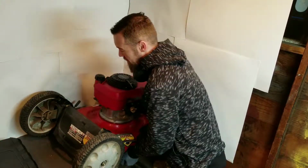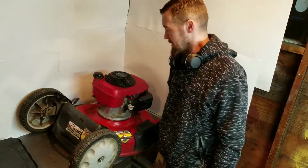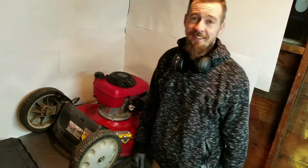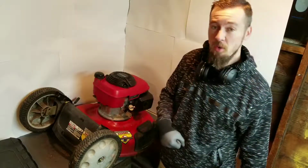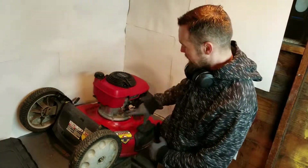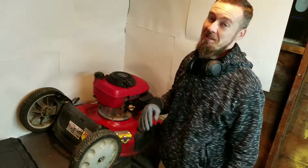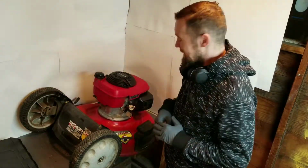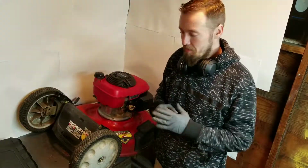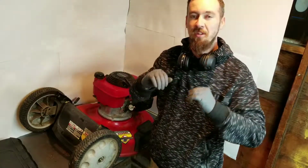And on these particular Honda units, I've had a professional guy come to the shop and tell me that he'd broken the sump. So he'd hit it too hard, and that bottom aluminum plate on the bottom of this engine broke. So that's what I'm telling you. Be careful. But it can be bent back into place, and you can start your engine and you won't feel the vibration.